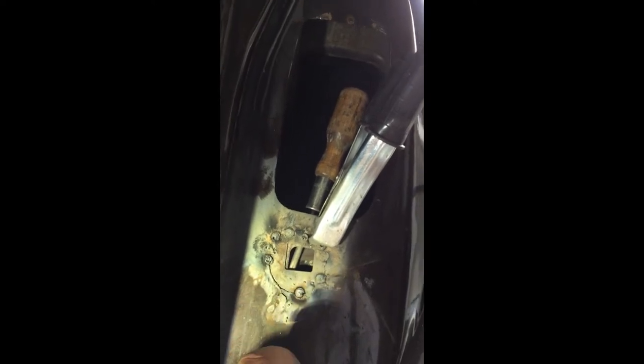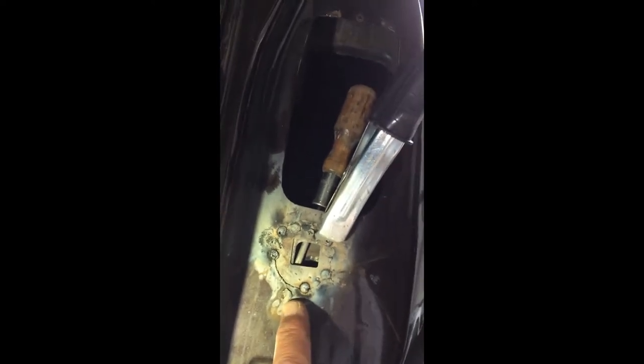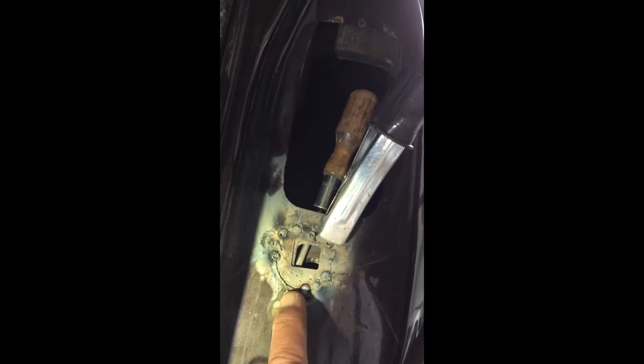It's kind of difficult. I've got my welder set about two and a half on the feed speed, on low or minimum, so just hitting it real light. You can see somebody tried to weld that crack right there at one point. I'm going to try to tap that back just a little bit more to get a better butt joint right there, then tag it a few more times, grind it down, and see what happens.